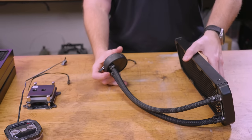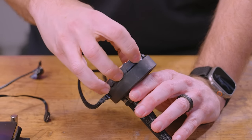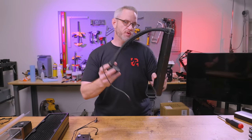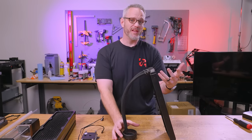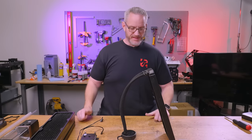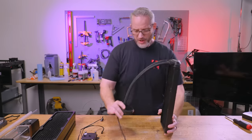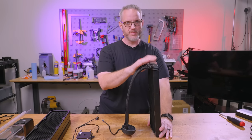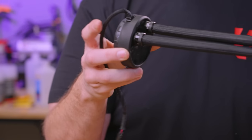What makes it interesting with AIOs is that nearly every AIO on the market has a combination pump and cold plate as a single unit that mounts to the CPU — or technically the GPU depending on the application. This is referred to as a closed loop because you can't service it. There are very few designs that allow you to open it up, take the coolant out, and exchange it. Open loop, on the other hand, is something you have to buy individually and assemble. These AIOs are pretty much non-serviceable, and a lot of them are just Asetek rebrands.